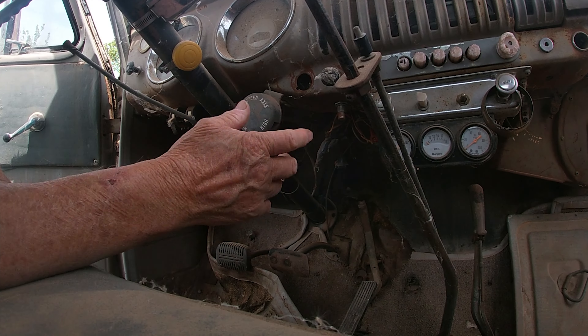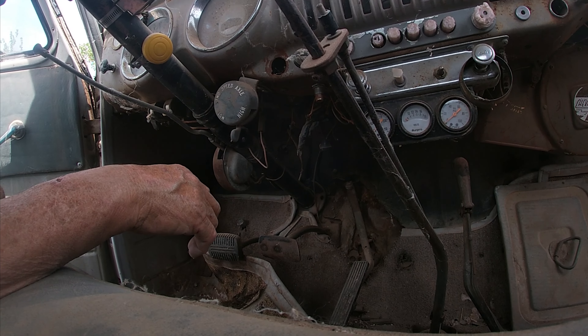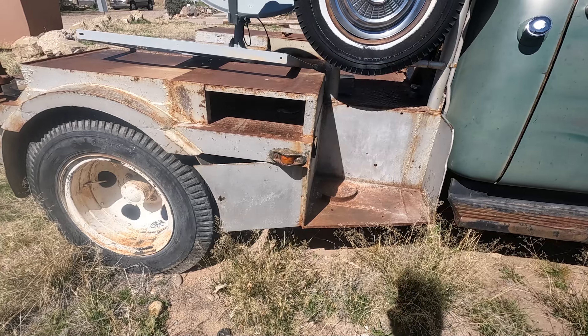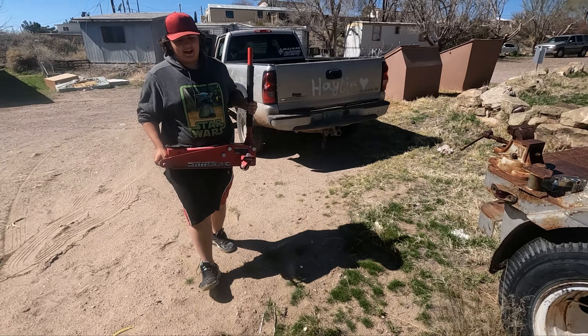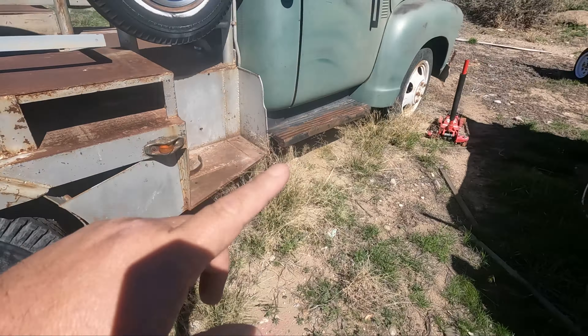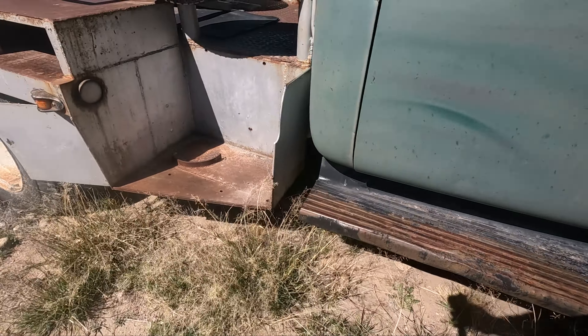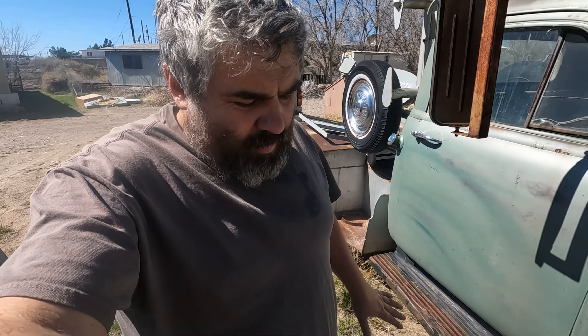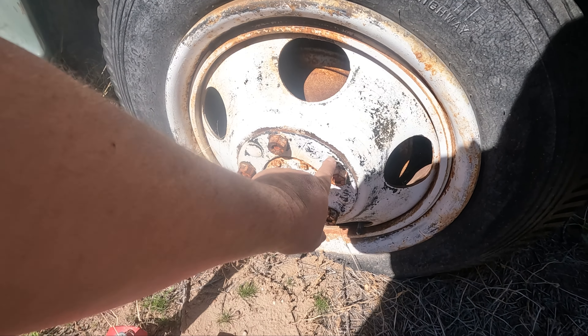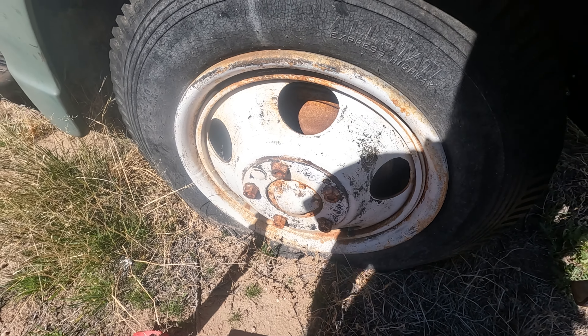You see a toggle switch? Oh, what's this? Oh wow — typical New Mexico, it ate away all the plastic. First, we got to make sure we can get tires for it. Pretty sure that the lug pattern from the front will match the lug pattern from the back. I know nothing about these tires, I know nothing about these rims — it's been what's been holding me back from getting this thing running. But I'm pretty sure that plate right there is just covering up the other five lugs because they don't need them in the front, and the spacing is exactly the same.